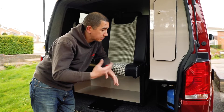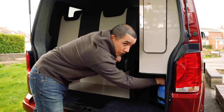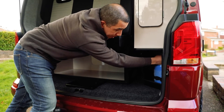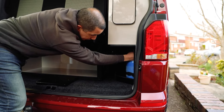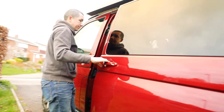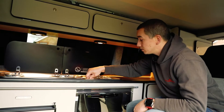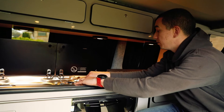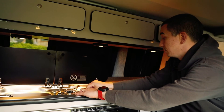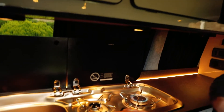Make sure that your gas connections are all working and that gas is flowing through to the kitchen area. First thing to do is turn on the gas cylinder in the rear of the van — the 907 — by turning the valve at the top. Then try igniting one of the burners. I can hear gas coming through and the piezoelectric is igniting it, so I'm happy with that. Try the other burner as well, just to make sure that's working.